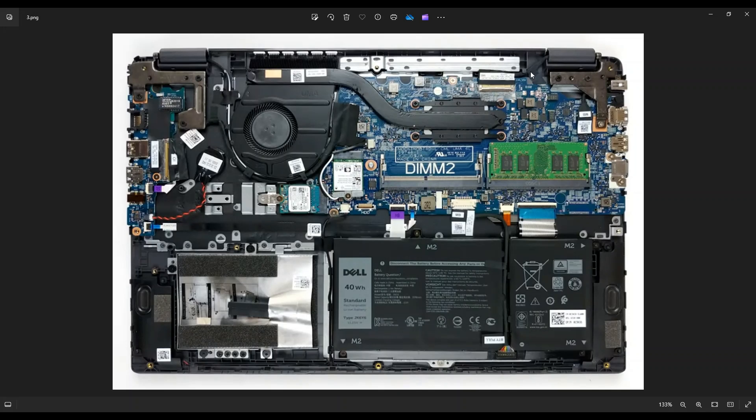This is your LCD cable coming down through this hinge assembly, plugging into the motherboard here. Your antenna wire runs up around your fan to the Wi-Fi card. If you're looking to get your fan and heat sink assembly out to clean or replace it, be aware there are a lot of cords running around that fan — you've got to unroute the antenna wire and this large cable going to the board, plus another plug there. If you're here to clean or vacuum out the fan, make sure you also clean the vent on the other side. If you're reapplying thermal paste after removing the screws and taking up the heat sink assembly, make sure you clean all the old paste off and don't put too much down — there'll be a video tutorial link below in the description.